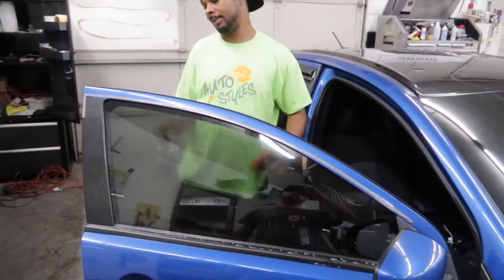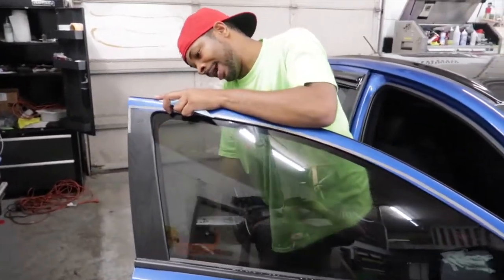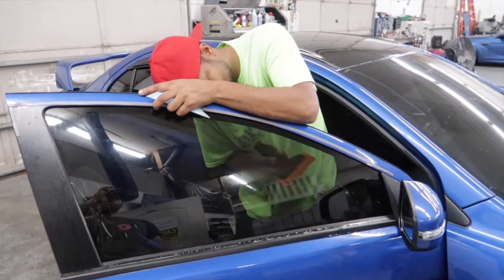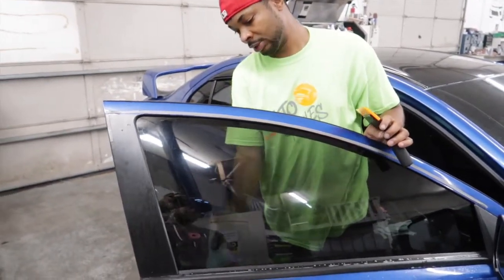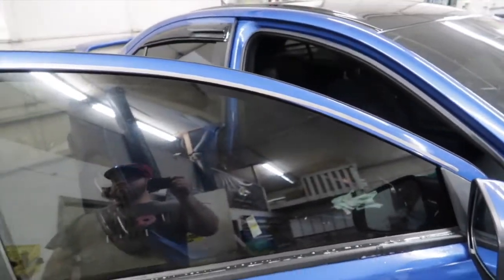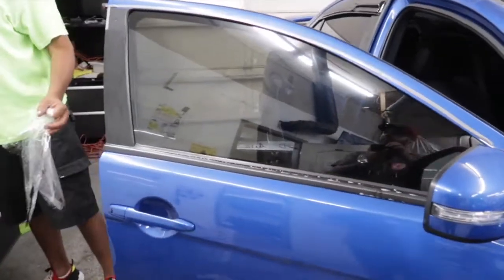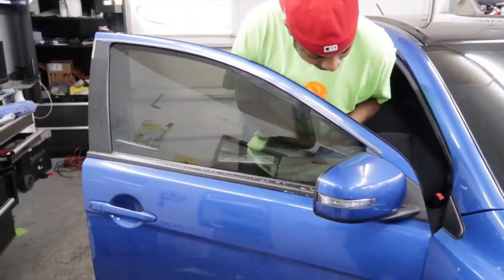It looks kind of crazy. It looks like we might have done a bad job — it looks like little bubbles — but it's actually just the water in between the film and the glass, and it normally dries out. If it's a hot day, I've seen them dry out in one full day, but usually it takes about two or three days depending on the outdoor temperature. There's nothing you can do to avoid that — you just have to let it naturally run its course. After it does that, it completely adheres to the glass. The film's cured, and you can roll the windows up and down. If we ever tell you you can't roll your windows down, it's because the film's still wet and it can peel or fall off if you don't let it run its course and let the adhesive stick to the glass.